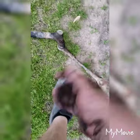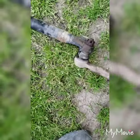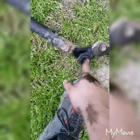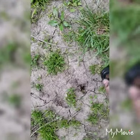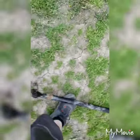and I left the other passenger side tie rod ends on it because I was going to replace them too, because the boot's all ripped right there and they move pretty easy, so you know they've been on there a while and are pretty worn out. But this is a Centerlink. This one's where the idler arm is. You can tell because it doesn't move. And this one's definitely worn out. And the boot's all ripped on this one too, so who knew what it was due.